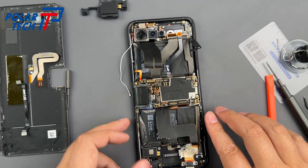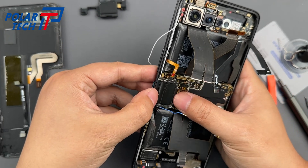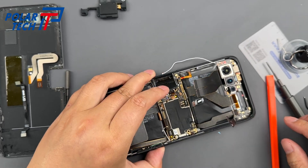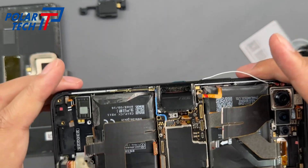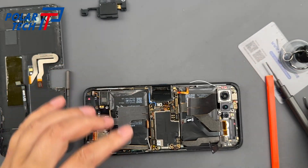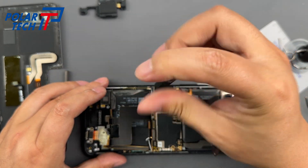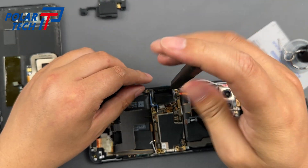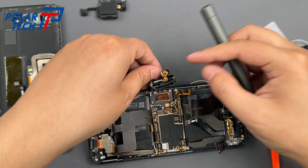At this point, the motherboard still wouldn't come out. Here's the trick — it's actually hidden under the Aeroactive Cooler's intake vent. Use a small blade to carefully pry open the vent, and you'll spot two more screws inside. Once those screws are out, the Aeroactive Portal Vent Module comes right off, and from there the motherboard lifts out easily.